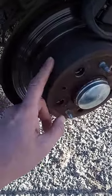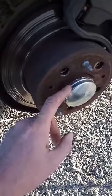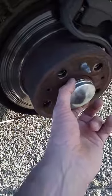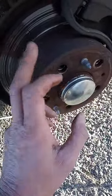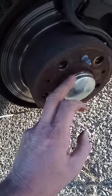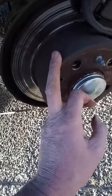I've ordered a second set of discs. The first set arrived and all the dimensions were right except for the inner diameter - it was too small. There are a few sets of sizes for these, so you have to be really careful and check all the dimensions when ordering, because there are about four different types for this van depending on which setup it's got.